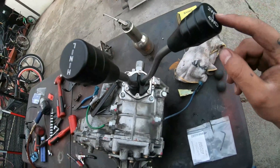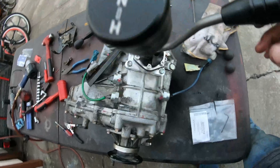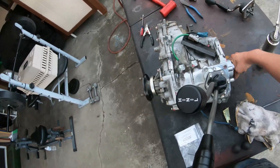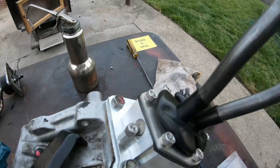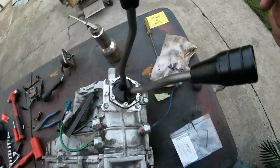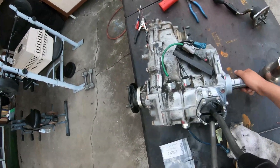Just to verify operation: we're in two-wheel drive high range — make sure everything works. Then you shift down to four-wheel drive high range. You can try low range — that's neutral, and that's low. Yep, it's low range. You can shift this back to two-wheel drive and get two-wheel drive low, and that's two-wheel drive only.